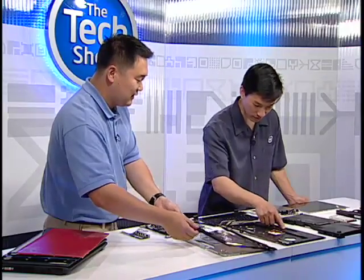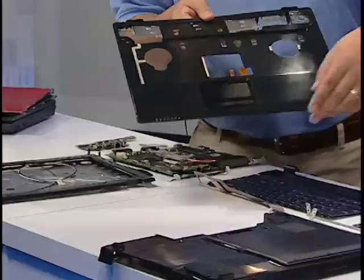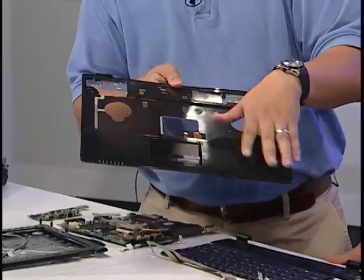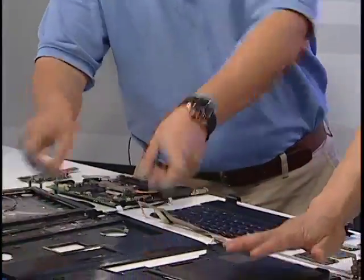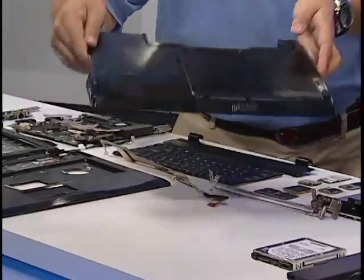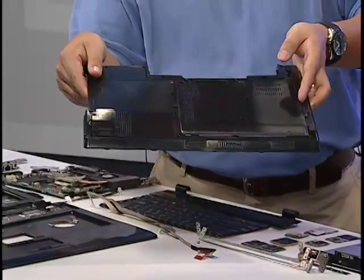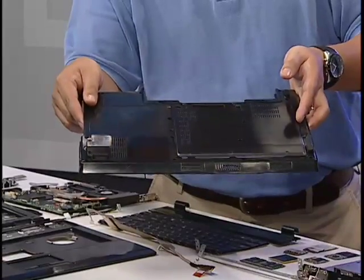Now, this looks kind of common here — I've seen this before. Yeah, that's called the touchpad. It's housed in the C-plate, and it's actually included with the C-plate. There's an optional fingerprint reader, which this one has. That's for security purposes? Yes, it is. Now, this is the bottom of a notebook. That's right. This is the bottom of the notebook, called the D-plate. This is where the motherboard resides, as well as the hard drive, the optical disk drive, and other components.